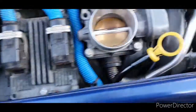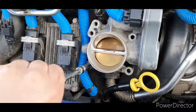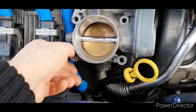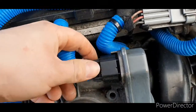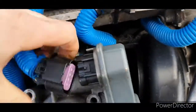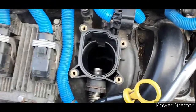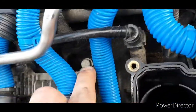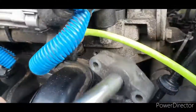That's the intake pipe off. Now I think it's time to disconnect the EGR pipe and ECU and throttle body next. That's 4 bolts and a plug. Yep, that's the throttle body off. Now, 2 plugs take the ECU off, and 4 bolts. Right, this is where we are. Just disconnected the EGR pipe. It's just 2 bolts there.